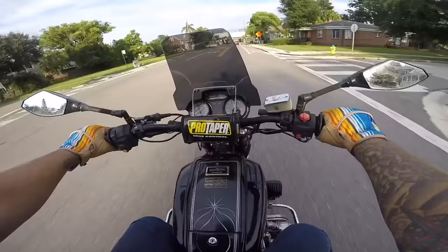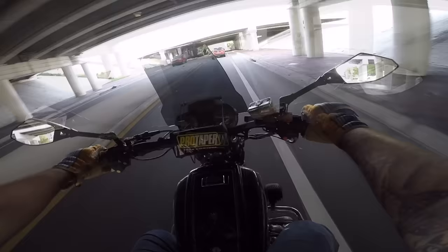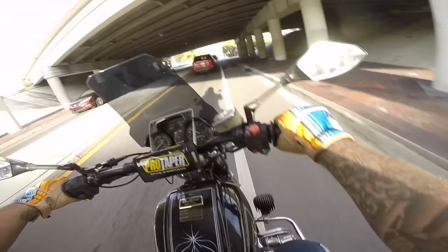If you guys have been watching along with the series, you know that I have delinked the brakes. So the rear pedal, which on a normal Goldwing would operate one front disc and the rear disc, now operates only the rear disc. And of course, I've got that Brembo from the GSXR 1000 on the front with an adapter kit from TC Brothers to fit the 2002 Sportster front end, which is then attached to a TC Bros floating disc on a 1997 Dyna front wheel. Yeah, this thing's a little bit of a bastard right now, that's for sure.